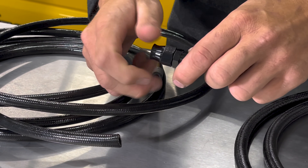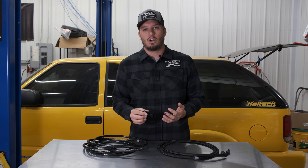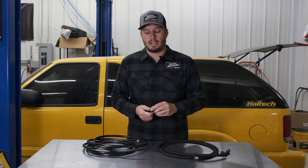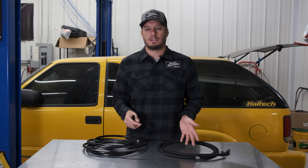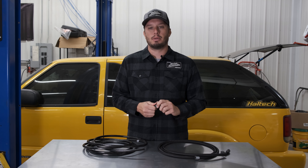We have a really good video showing more depth on how those assemblies go — we'll put that in the description below. It shows us assembling all the different style lines and fittings, including crimp fittings, which aren't pictured here but can also be used. On the PTFE, as I mentioned, there's one more step. Not that it's impossible to do, but you will find yourself fighting with it a lot more than a standard nylon hose. For a beginner or novice, it definitely adds a bit more complexity to building a fuel system.